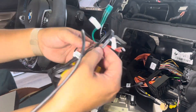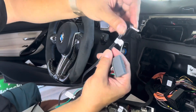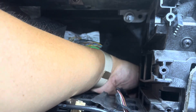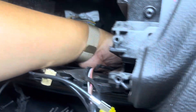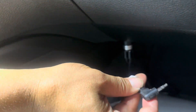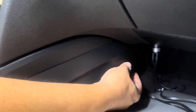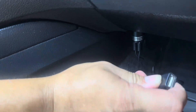There's also an aux audio cable here — we'll have to route this to his aux port. Right now I am routing the aux cord through the bottom. I have the aux cord now, pulled it out through this bottom trim. Routing the USB cord through as well and feeling it on the other side. And we are giving birth to a USB cord.